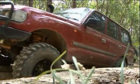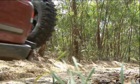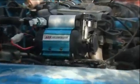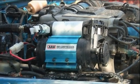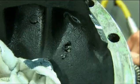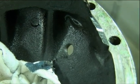The reason the air locker is the number one traction choice all over the world is the simplicity of its design. Basically, the first thing we do is mount a small 12-volt air compressor under the bonnet. We then run a 5mm air line from the air compressor along the vehicle chassis rail and down into the diff housing.